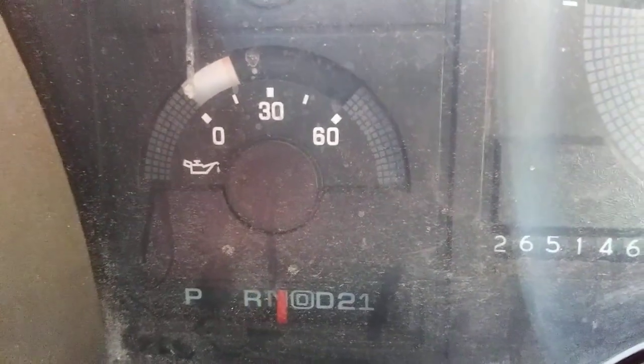Take it out of gear — no noise. You'll also find that this whining noise will kind of fade out as you take off, and when you shift from one gear to another it'll come back in slightly. I'm going to show you what that problem is.